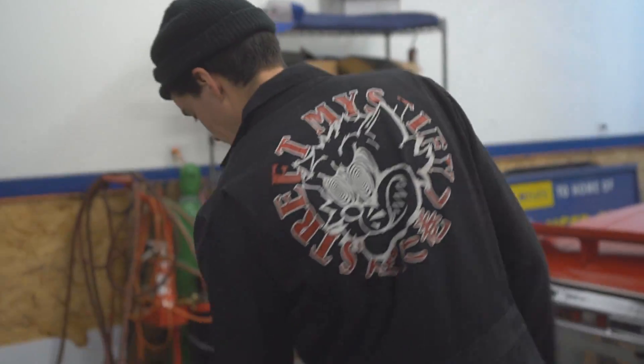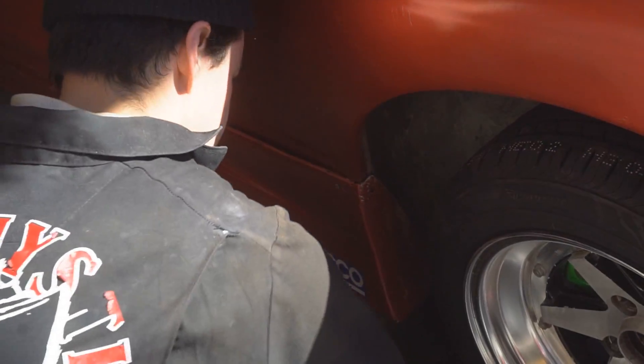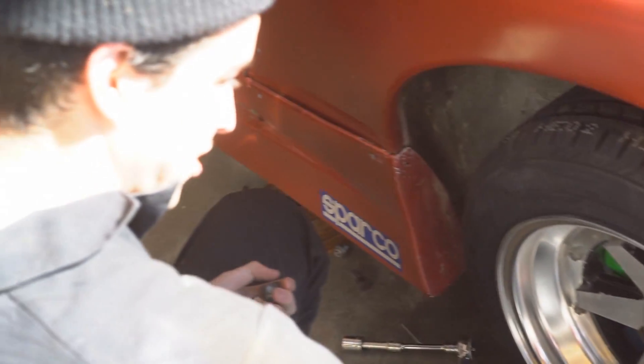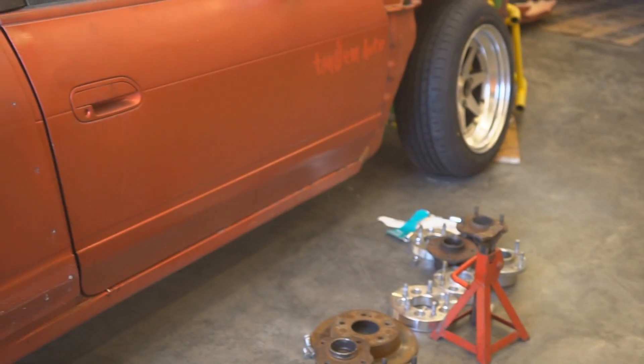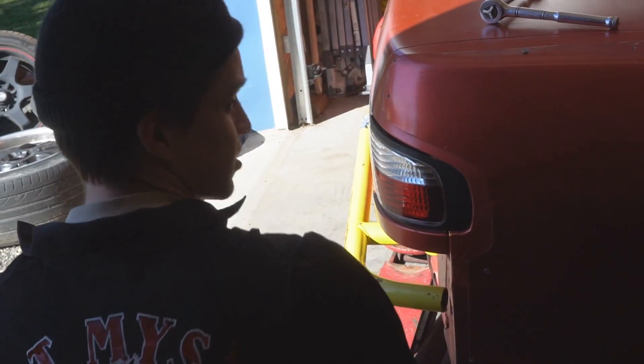We also have to get the rear wheels on the hubs without spacers because the spacers are on my Corolla now, so it might be kind of difficult. A lot of people suggested loosening the hub nut on the front wheels - I think that might be the issue. The rear wheels fit without a spacer and just clear the calipers on their own. Now we just gotta drop this, get the jack on the front end, and try to figure out why the wheel is binding.